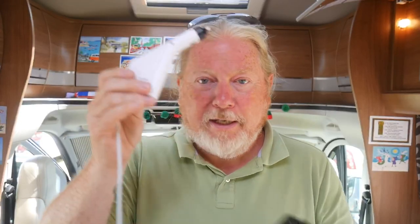I use a similar socket on the TV socket at the back which is rated at four amps, and this 12 volt outlet is rated at a max of 10 amps. Actually, looking at this again, it says 3.65 amps on a continuous draw, so I won't actually need any more than a five amp fuse for that one — and that's for the laptop charger.